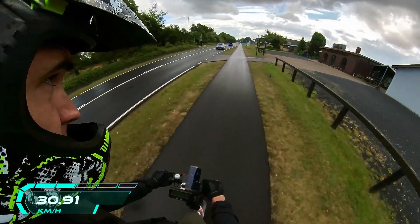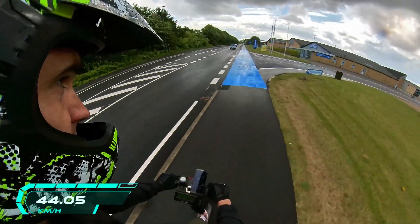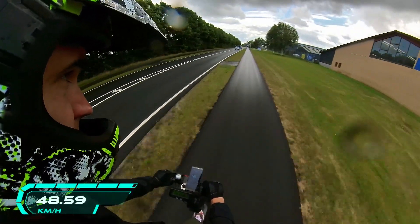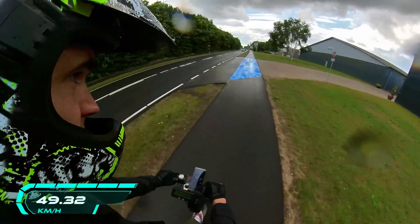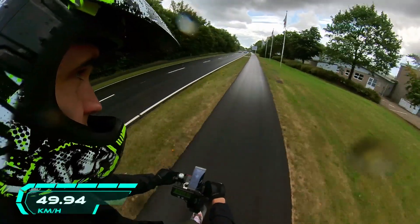Even with the wheel at the back, I really need to focus on my driving to keep the handlebars straight, because they really want to wobble with the battery installed on the stem. Do not install batteries up there — batteries need to be down in the deck. On good quality road like this, it's not a big deal, but when it gets a little bit shaky, I don't want to think about what could happen.